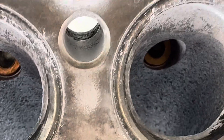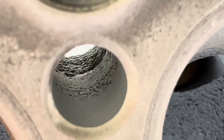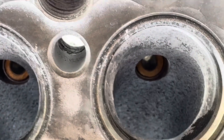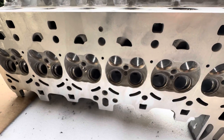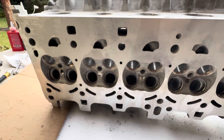This next one over here is probably the worst — really bad. You'll see the level of corrosion and pitting at the end of that hole, and even about halfway down where the seal would be sitting, it's already corroding. They're not oval shaped, but I'm concerned that all that corrosion may lead to an issue. So I decided to do this kit as a pre-emptive measure, installing the injector bore repair inserts.